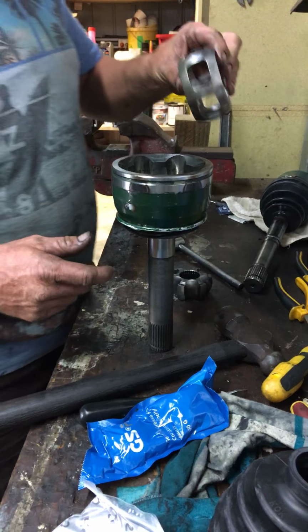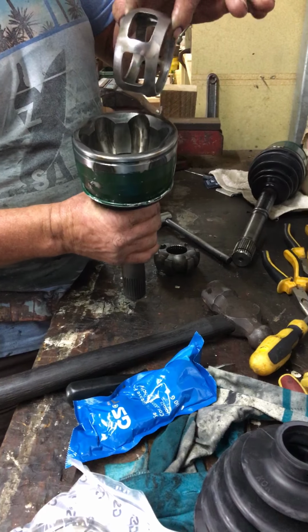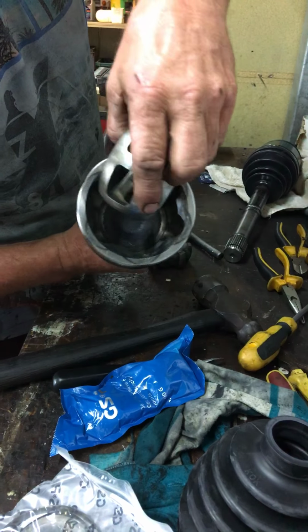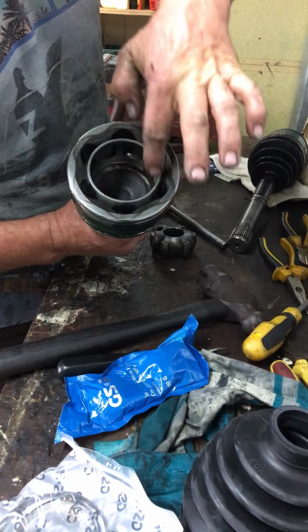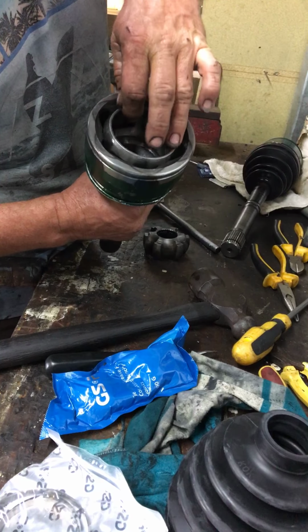So again, when you go to put it back together, here's your knuckle all nice and cleaned up. That's actually your drive shaft axle. So the slots on the side, line them up with the lump here, and it just drops into place and pivots over. Remember, two different surfaces. Okay, so that pivots over.